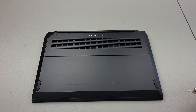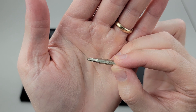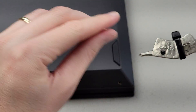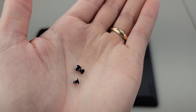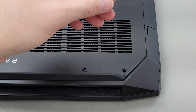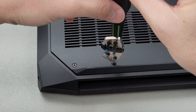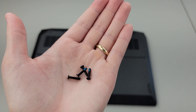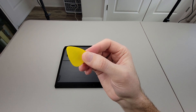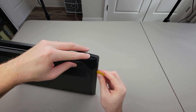Let's remove the back cover. There are seven screws — three in the front, four in the back. Use a Phillips 1 screwdriver to remove the screws. Carefully pry off the back cover; I'm going to be using this guitar pick. I recommend using a plastic object, as a metal screwdriver could mar up the side. It helps if you start by the USB port like I'm showing.